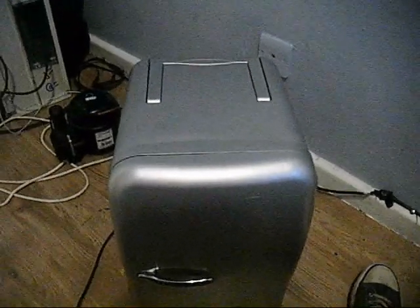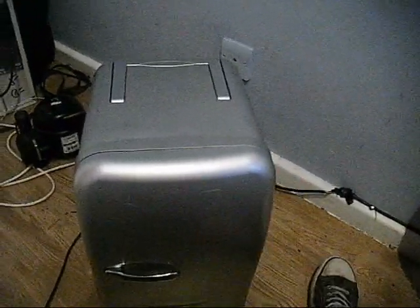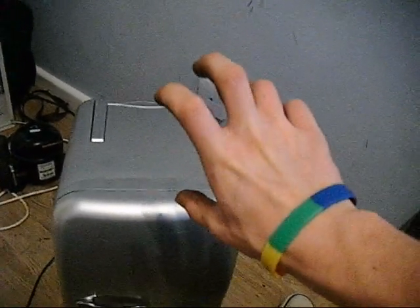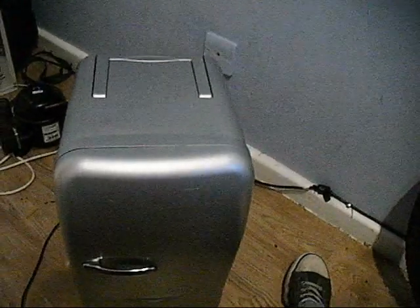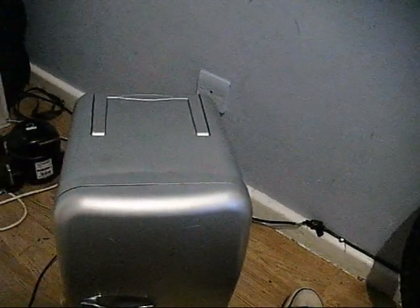This is that little fridge which I got two days ago. I still haven't edited the video — I would have uploaded it by now, but I'm too lazy. He saw me get it taken apart and clean everything up. The fan was a bit dodgy — only some of the windings inside the motor were actually working, and the magnetic fields would line up and it would either stick or just hum at you. It wouldn't do anything unless you turned it manually, and then it would spin up but not as fast as it should.